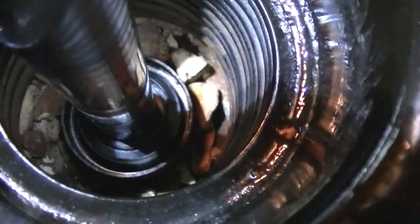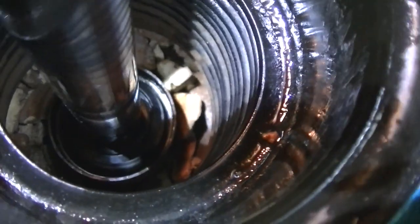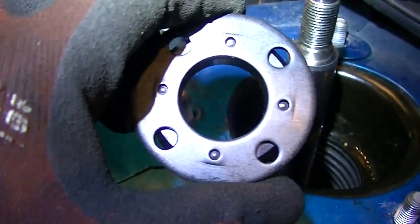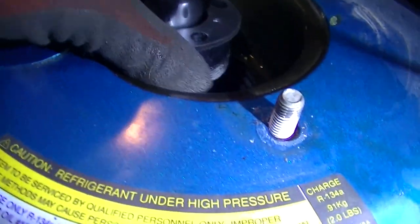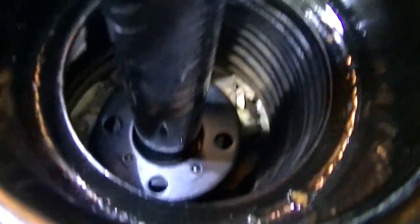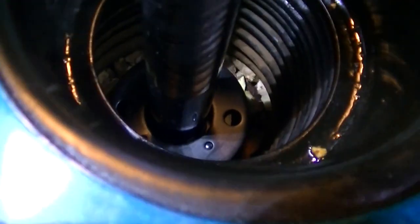The replacement strut just literally gets put down into the cylindrical hole, and we're going to go ahead and put everything back together. I'm going to use the replacement cap here for the threads — I put just a tiny amount of anti-seize on it to help thread it on. You may notice the side of the strut tower, so you kind of push the strut out of the way a little bit, get it started and threaded by hand, and keep on going.